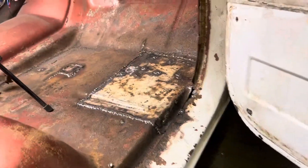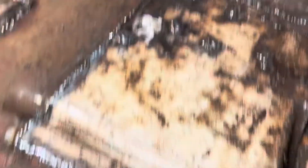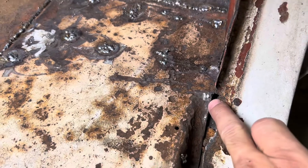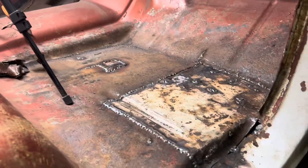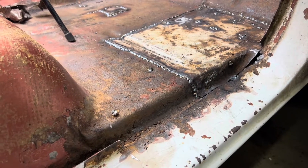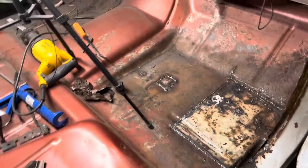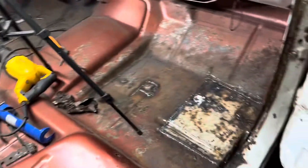This is where it's at - I've got it all tacked in. I got this piece taken care of, the plug weld over there taken care of, all the spot welds plugged up. It's not pretty but it's not rusted out anymore. I still have to fix this piece, cut this out, clean up back here, attach from here to the inner rocker, put this piece in, and put this piece for the rubber. I'll start part three when I get all this fixed - putting the POR-15 down, seam sealing all the patch panels, and getting it ready to go back together. Thanks for watching.